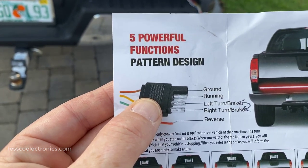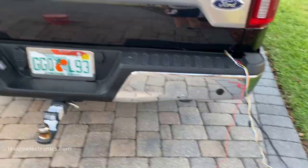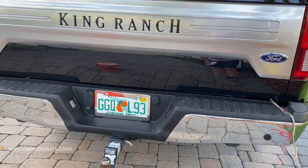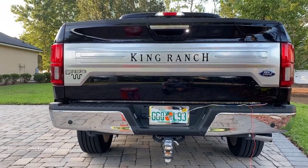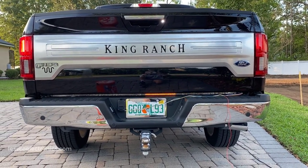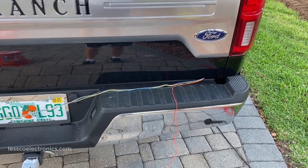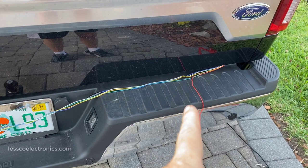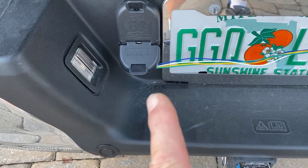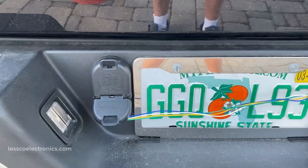That's not right. Yellow is actually your right and green is your left — I confirmed this with my power probe. I was like, why is it that when I put on the left blinker the thing is blinking on the right? Go figure. Otherwise it looks pretty cool. There's my left blinker on and the right side is going. I love Chinese tooling — it's the best. So let that be the first part of this review: wire it hardwired and the left and right are labeled backwards. I will not be using this plug. But if you install it and get the backwards syndrome, that's why.